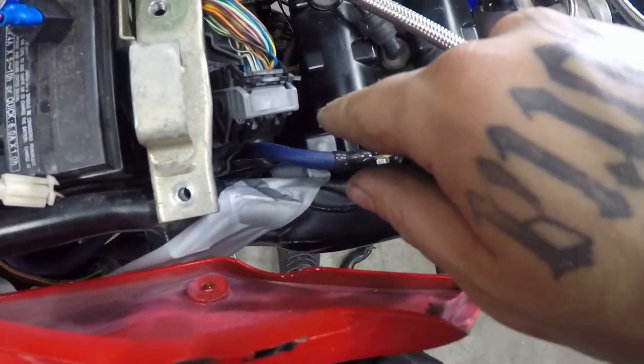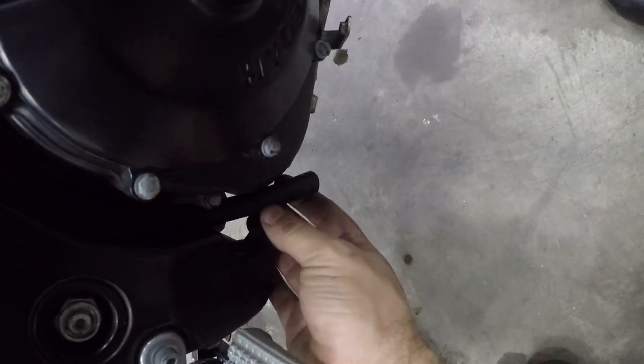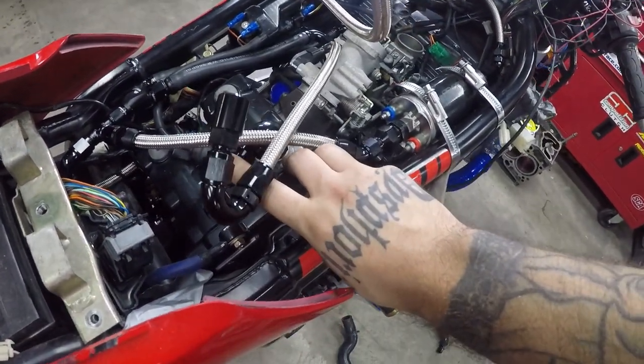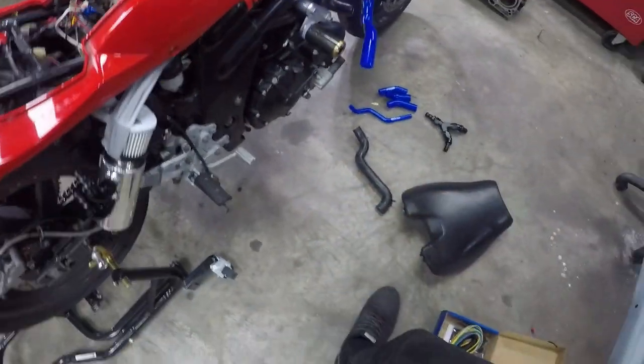There is another rocker cover breather, the OEM one, which is quite small down the bottom there, and that just kind of feeds straight out, straight down. So I might just cap that off because this bank is actually maintained by this one, I guess. Or I could just leave it like that, but that kind of negates the point.